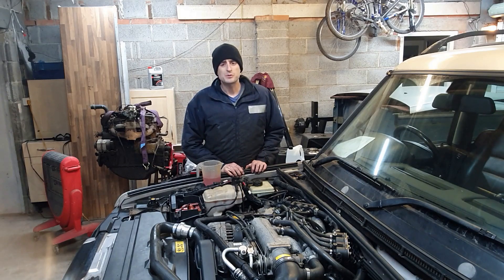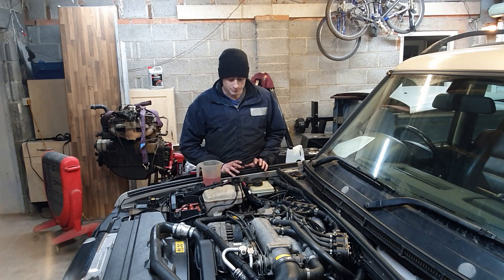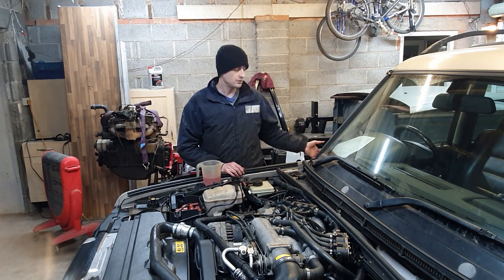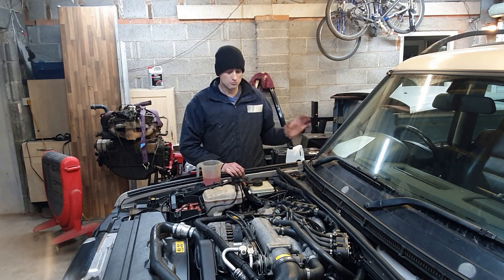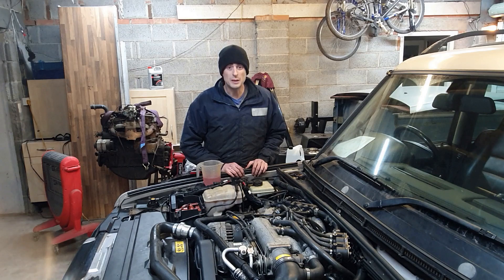It's in the timelapse — it's all back together now. Once again I'm full of nerves. I first started this car on the 8th of December, although you'll have got the video quite a bit later than that. Today is the 24th of January. I've been chasing this fault for a long time. Here goes — I've primed it on the starter with the injectors disconnected, I've cleared the fault codes, and it is ready to fire up. The garage door is open so I can run it for a while and see if it is quiet or not.